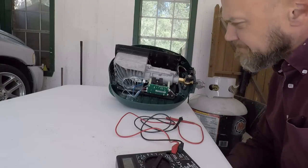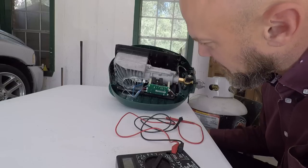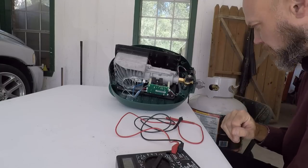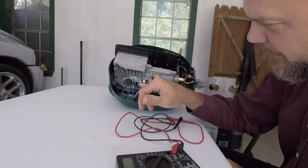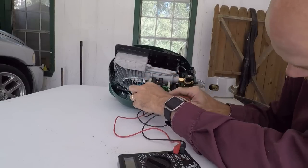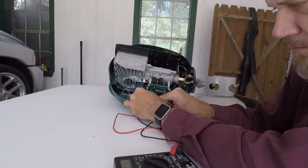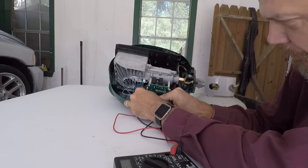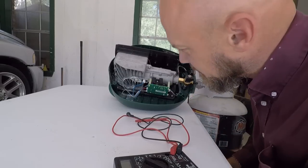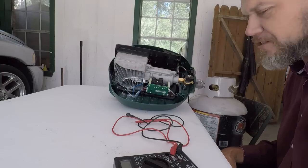I'm going to shut her down and give everybody a little understanding of what's in here. I'm going to pull a couple of these small pieces off and check my propane flow - which obviously it thinks is fine since this valve is wide open and it just did a full startup properly on its own. I'm going to check that resistance again to see if it's notably different now. Right now it is down to just 13,000 ohms. It has developed enough temperature in there to drop that resistance to the point where it will allow the whole thing to keep running - it was at 100-something thousand before. I wonder if there's a buildup internally and it's getting insulated, having trouble getting that resistance down.